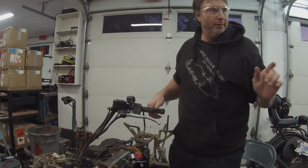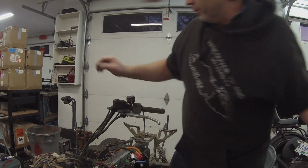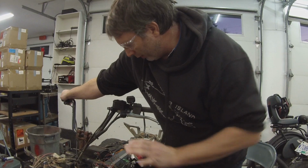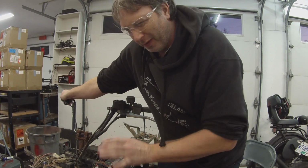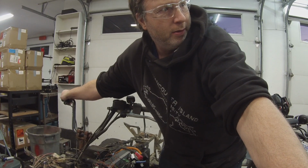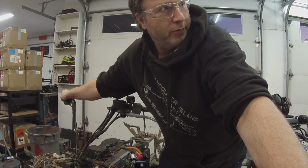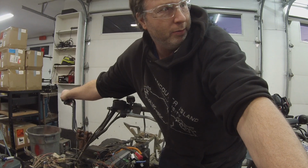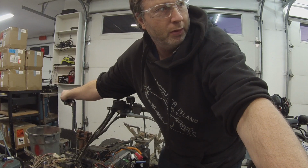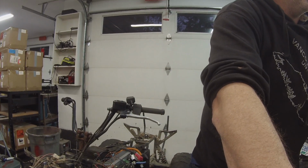So what I'm going to do is get it spinning, and you want to spin it around 1,000 motor RPM. This quad's nice because I can put it in neutral like this, and it has very low load on the motor, so it's going to get us pretty close with timing. So we'll get it spinning a little bit, then we're going to start this trace. I'm going to bring it up to about 1,000 mechanical RPM. We'll hold it there for a bit, and then we'll stop it. And then we're going to have a look at this trace.